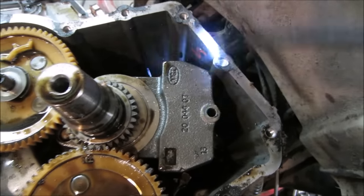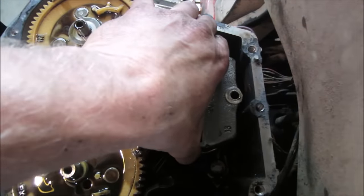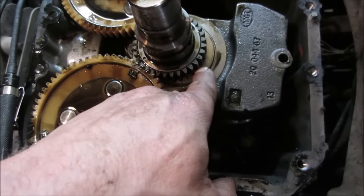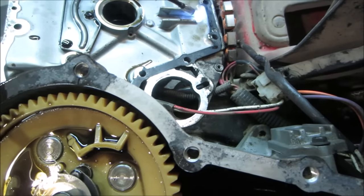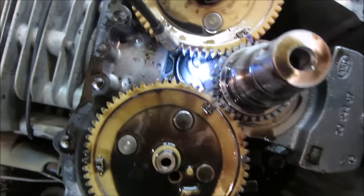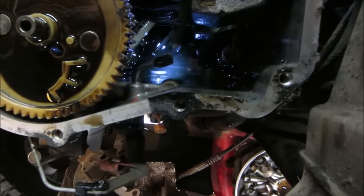It's got to be whatever was right here that kept the crank in a straight line — this counterbalance. The rod bearing would be lower. I think this counterweight seized up and spit out the bearings — it just got to be too much on that pin. That's why even on that cover it's got those beat-up marks. It was probably binding, working real hard. Normally it's a smooth flow back and forth. The rod looks fine — I don't see any blue around it. This counterbalance is what let go. Let's go grab a magnet and fish out all the little pieces.